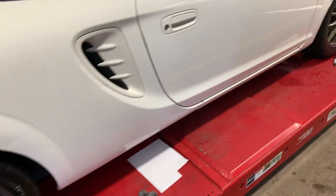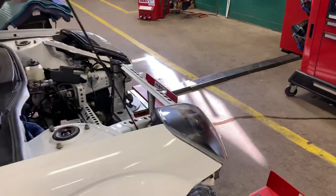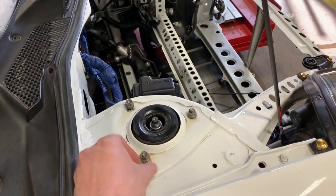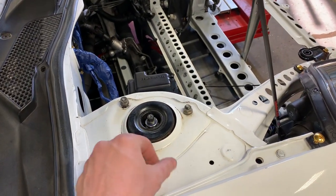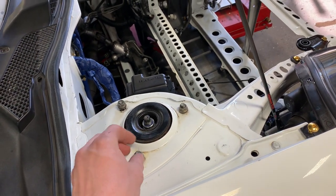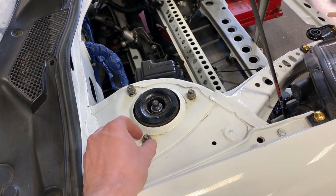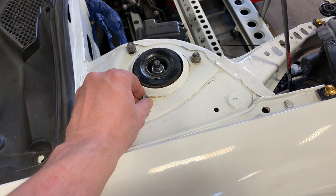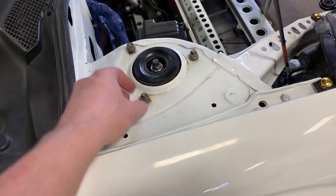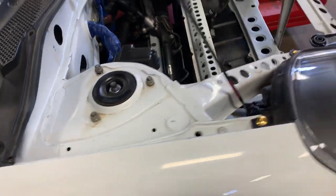People are so cool. Some of this stuff's going to be aluminum, some of it titanium - these are more M8 by 1.25s. Because they're suspension bolts, I'm going to do them in titanium. The only time they're really under any stress is probably when they're in tension when the suspension's drooped out, but I just feel like it's probably the right thing to do.